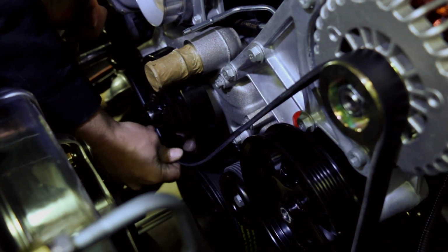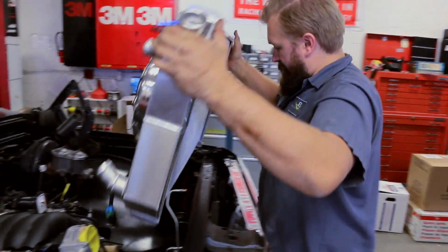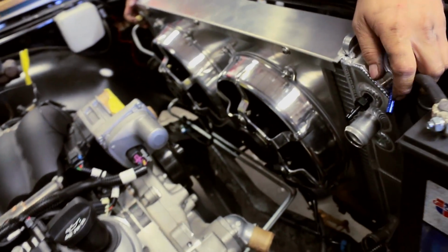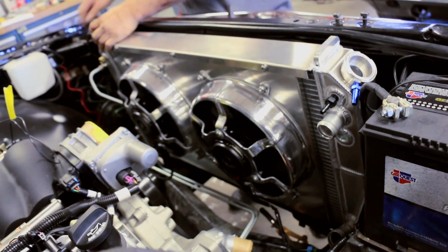The last thing we had to address was cooling. A 480 horsepower LS motor with an automatic is going to generate some heat, so we used an Entropy Radiator to make sure we kept up with the AC on and all the horsepower, even on a hot day in a black truck. The Entropy Radiator we used is a direct bolt-in, as are many of the things they make. We like them because of the simplicity.